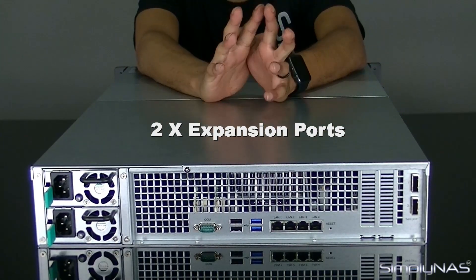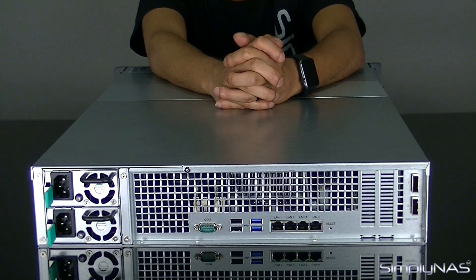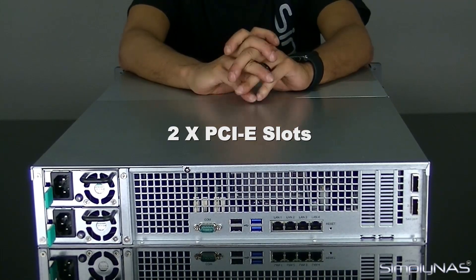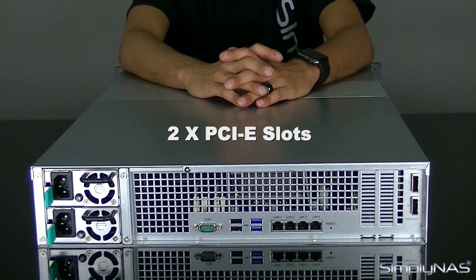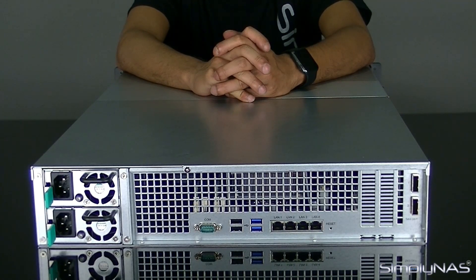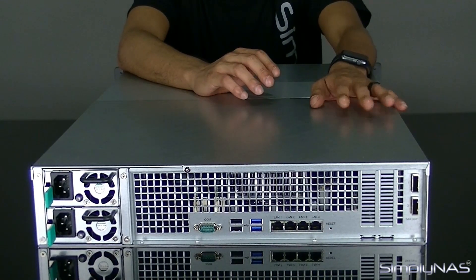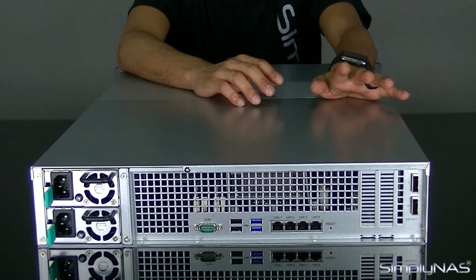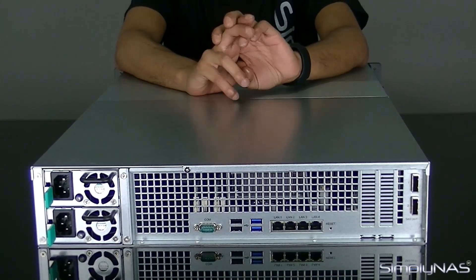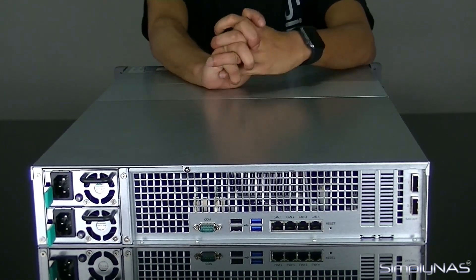On the left-hand side, you've got your expansion ports — these now come stock on the unit; you don't need to buy a card anymore and have it installed, so you don't use any of your PCI slots. Right next to them you've got two PCIe slots this time, giving you the ability — for the first time in a Synology — to put dual 10-gig NICs into the NAS. That will allow you to have four 10-gigabit ports total; you can do aggregation on them, though bonding two different cards together typically hasn't worked well on Linux-based architectures.